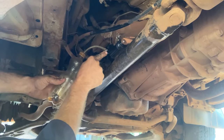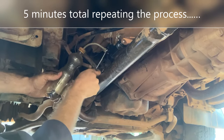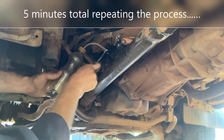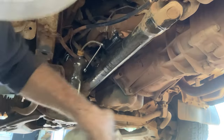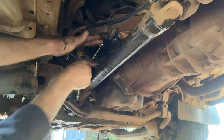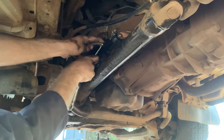Are you holding? Yeah. Okay, pump. One, two, three — hold. All right, so we're getting close to the end here. Watch this right here — it's stroking almost all the way. So we loosen and it fills with bubbly fluid.